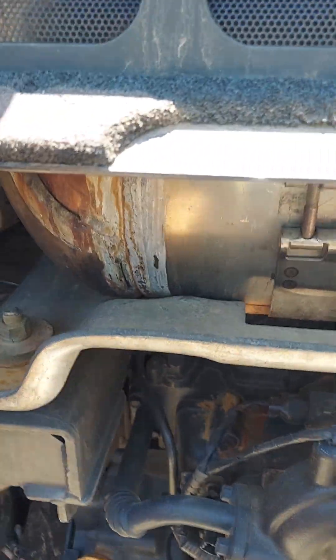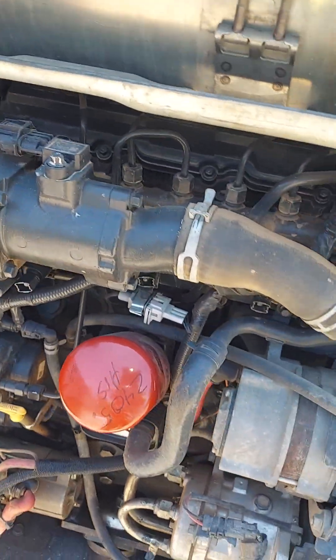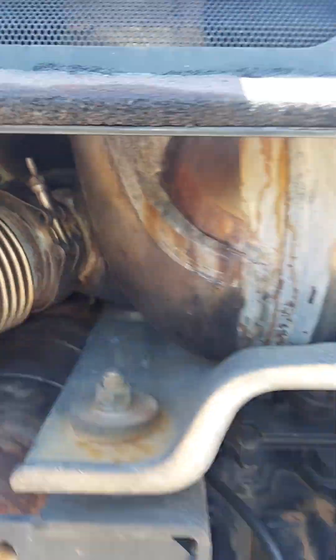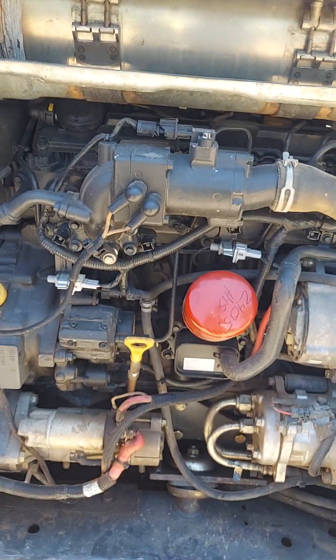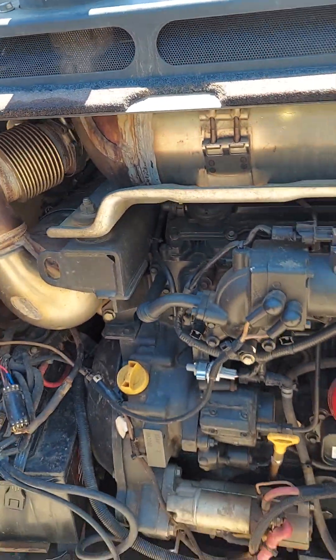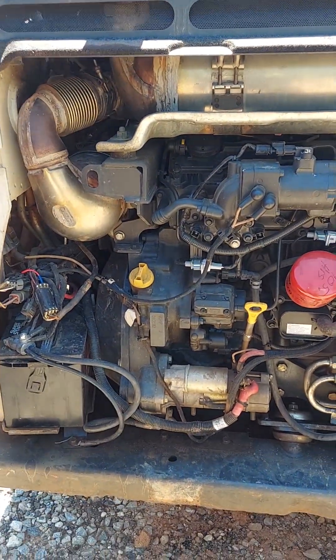For really easy access, take this cover off right here — one bolt here, another one there, and then those two 9/16 bolts. Once you get that off, take your sensor out and I guarantee it'll be really dirty. Especially if it's been idling too long, or if the pipe is messed up and water gets in. Once you take this cover off you'll see the exhaust pipe exposed — water, debris, dust, you name it — but that's pretty much what fixed the issue.